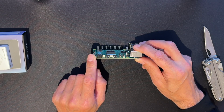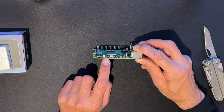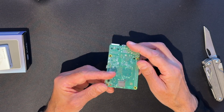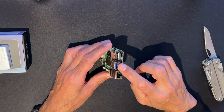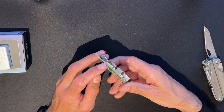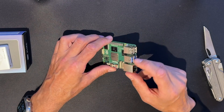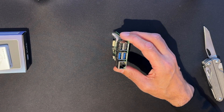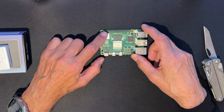We run our Pis headless, meaning there is no screen attached, but even in the setup process when connecting a cable to this device it is a bit dodgy. You've got a micro SD card reader here, but I never use that now. What I do instead is insert a USB key here and the operating system is installed to the USB key, because ironically this SD card reader is not as fast as running the operating system from a USB key. So one of many tips: don't run the operating system from the SD card, run it from USB. This model has got USB 3.0 interfaces, full Ethernet, and for hobbyists who want to control stuff, there's the GPIO bus.